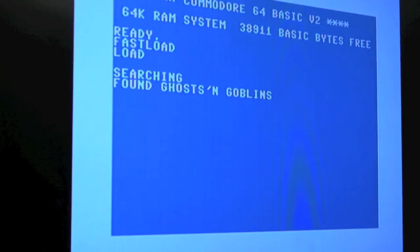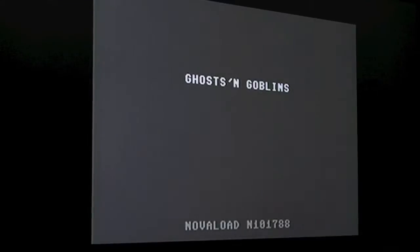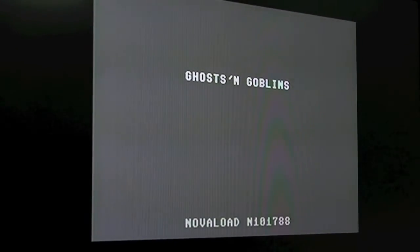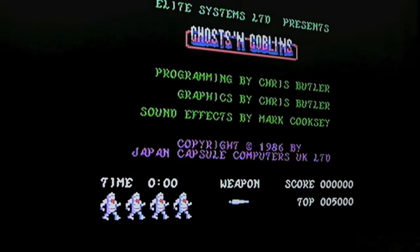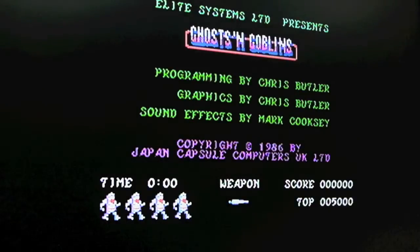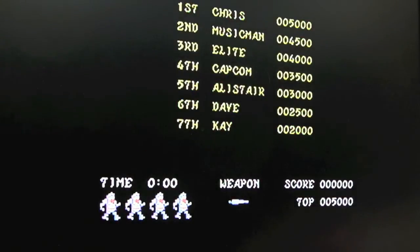So I'll give it a try now — see if the game will load. There you go, it's found the game. Pressing the Commodore key should get an overload screen. I'll just fast-forward until this is finished on the final stage. The screen display has just gone off — typically that's because it wants to free up that area of memory for the remaining few K of code. And there we go — the tape has stopped.